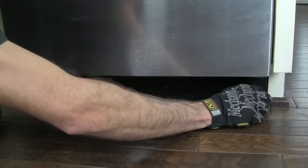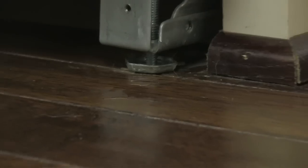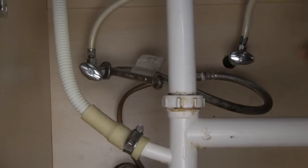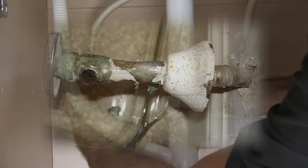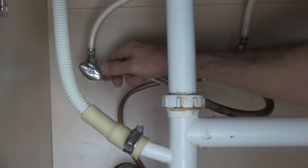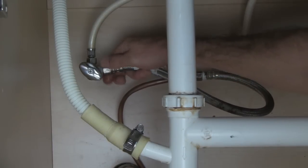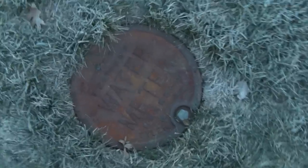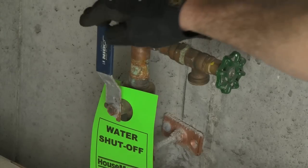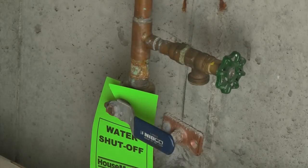Removing the lower panel will allow you to clearly see if the dishwasher's feet are behind or on top of the flooring, and how much extra room you have to work with. The most common difficulty with dishwasher removal or installation is old plumbing. Old corroded water valves should be treated with extreme caution — they should ideally be replaced. Even a light bump can cause an old valve to start leaking. You should also know where your home's main water valve is before you start, as using it is sometimes less risky than using the valves under the sink.